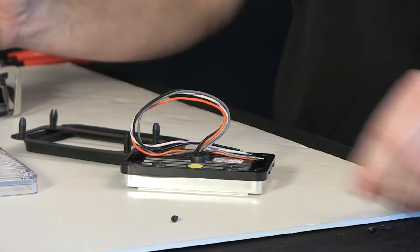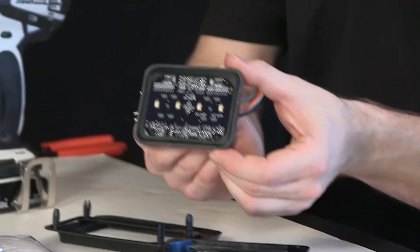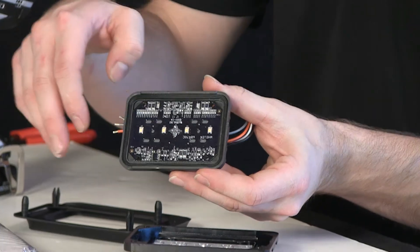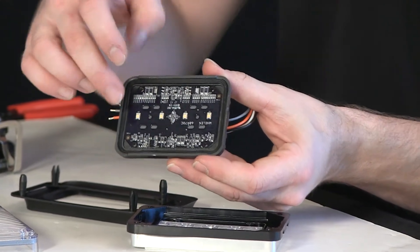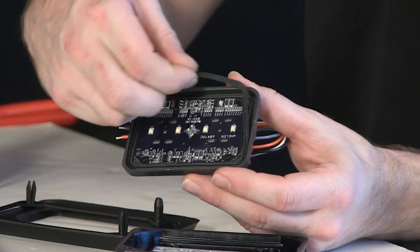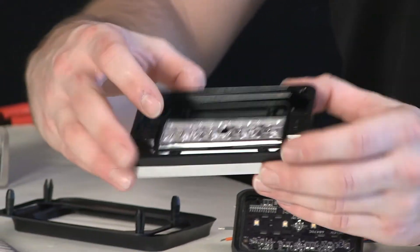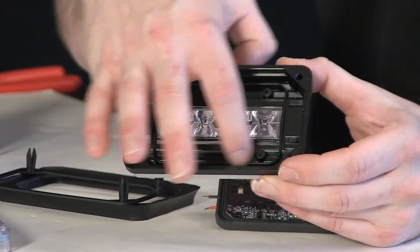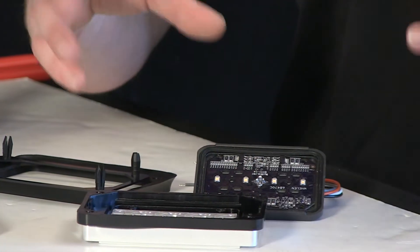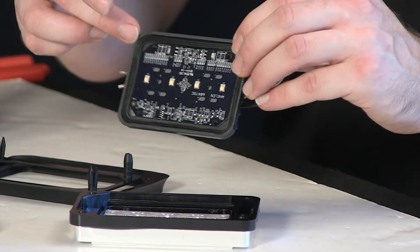And last screw out of the back there. This is your array for the 400 Series light head. Here's a better look at the four diodes — center mounted in a linear pattern. The unit has an incorporated gasket, so this helps seal the electronic assembly into the polycarbonate housing. So when it's seated back in and screwed onto the reflector, everything's nice and tight — keeps grit and grime from getting into the light head portion.